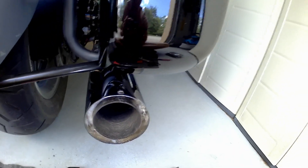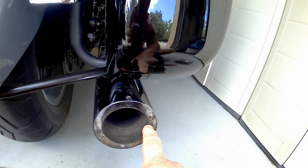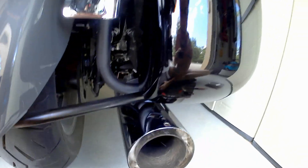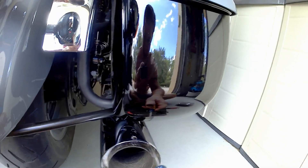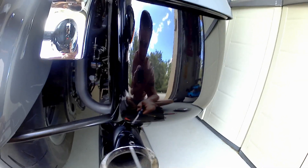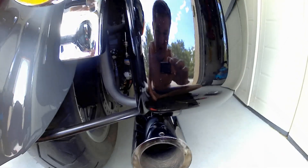There's no problem with the fiberglass itself, but again it starts to make its way out. So what we're going to do is take some of this stainless steel wool and actually pack it in there nice and thick, and push some of this back so that the stainless steel is now up against this tip here, preventing any of this material from making its way out. I'm going to use a little tool to go ahead and push some of this back and stuff the rest of this in here with stainless, and that should prevent this stuff from ever trying to make its way out - because nothing worse than a hairy hole on your motorcycle.